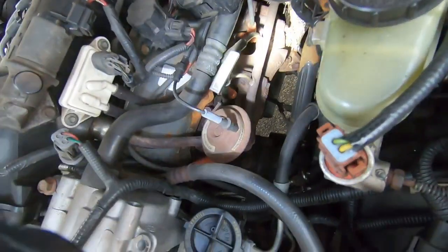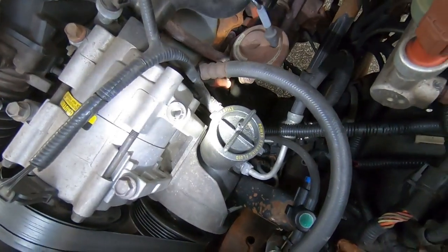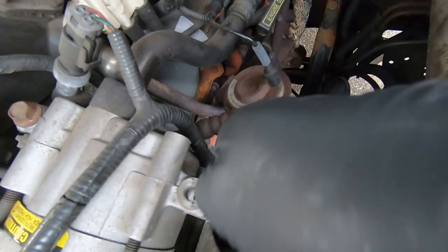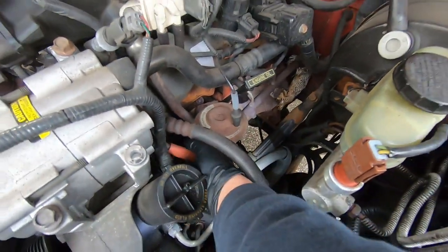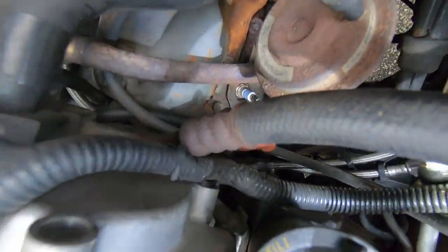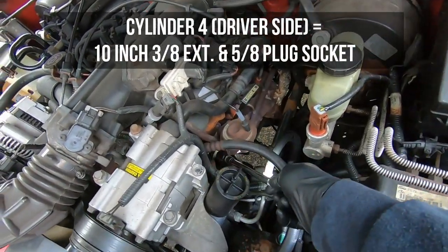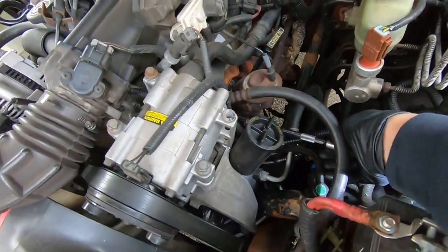There's the rear, there's the middle, and there's the front. We're going to go ahead and start with this front one right here. This should be a pretty easily accessible plug. I'm going to sneak my hand in here and pop that wire right off. Got some good space there. As you can see the plug — we'll go ahead and get our socket and socket wrench and get that thing out. Going for a little bit different setup here — it's a little bit longer reach than we had on the passenger side, so I have a 10 inch extension on the socket.